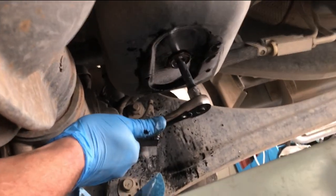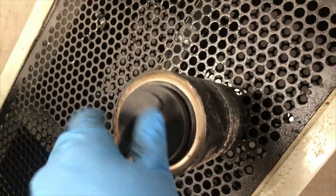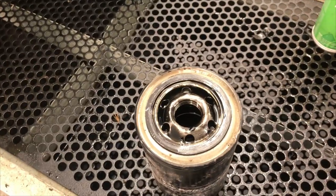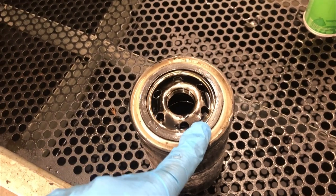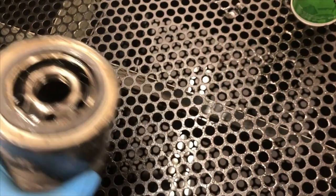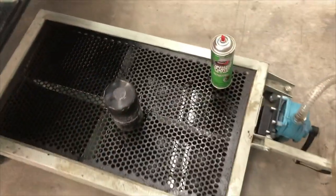This is my very first diesel oil change, but it's only about my bazillionth oil change overall. They all go pretty much the same: find the drain plug, drain the oil, get the oil filter out, and replace it all. Always, always, always make sure the rubber o-ring came out with the oil filter. I've seen more than once where it sticks to the car. If you put a new oil filter in and you have two rubber seals next to each other, it will not seal — it will dump all the oil out in just a few minutes, and that will be the end of the engine if you don't catch it right away. Always check for that on your new oil filter.